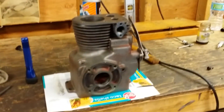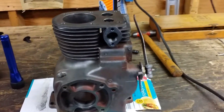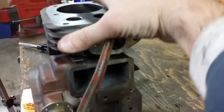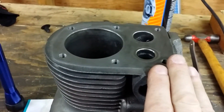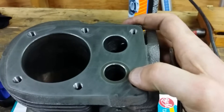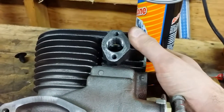What I've done is started work on the K90 that was originally on the tractor — the one that started to push a little oil. I've fully stripped it down and cleaned it, so it's pretty squeaky clean inside. I hit the decks with a cookie wheel on my die grinder — just a scotch pad on a die grinder — cleaned the deck up. I took my Dremel tool with a fine wire brush, cleaned the seat, and also cleaned the insides of the ports. It's all decarboned, and the intake was a little bit rusted.